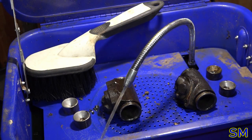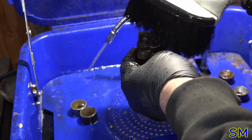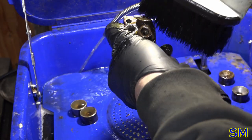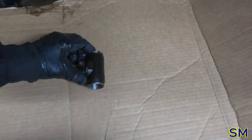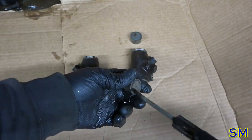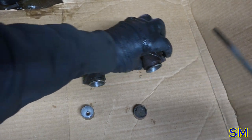Right, let's go ahead and clean these up here. I'm gonna give these a nice little scrubby scrub. So that's probably gonna take a hot minute. Get the pistons cleaned up too, and catch you guys on the flip side for reassembly. Okay, we gotta do this quick because there's supposed to be oil in here, not solvent. So we gotta be quick about this before it flash rusts on us. And yes, for point of reference, I've already blown out all the passageways and all that fun stuff.